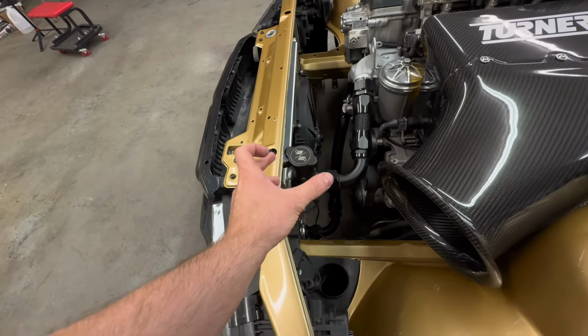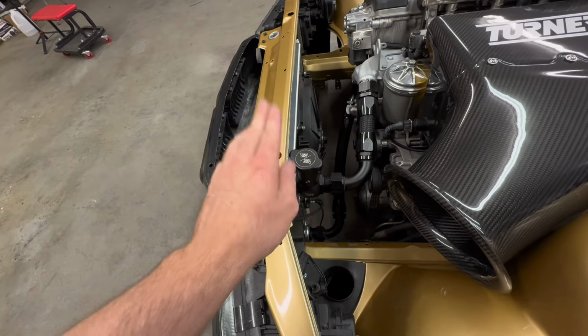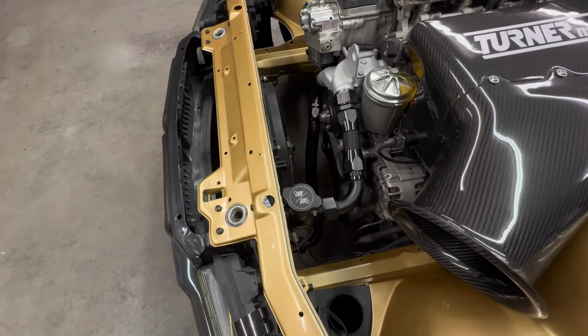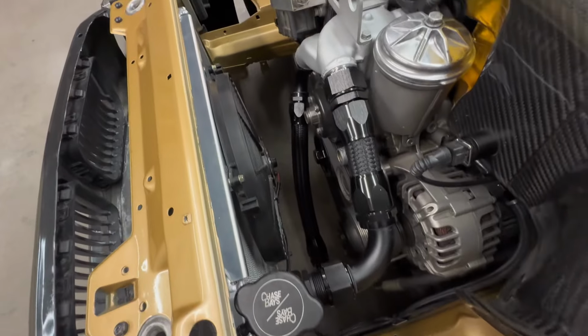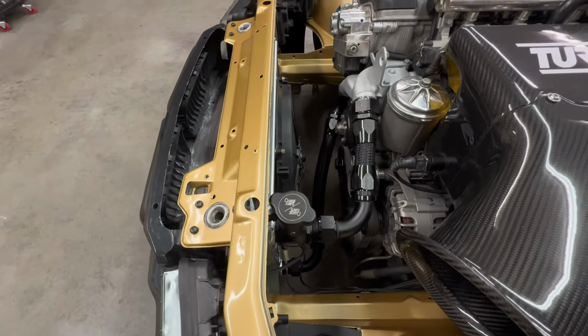The pressure is obviously going to make it rise up, so after you turn the car back off, it's going to kind of sink down. So fill again, and once it's done sucking up coolant, this thing was pretty much good and ready to go. So I made sure I tested it. I've driven the thing probably 2 or 3 days now and got no leaks, no problems, holds perfect temp, fan kicks on when it should, so install complete.